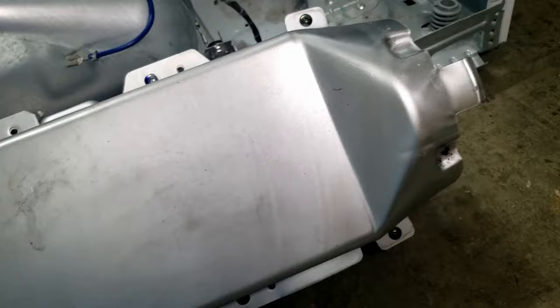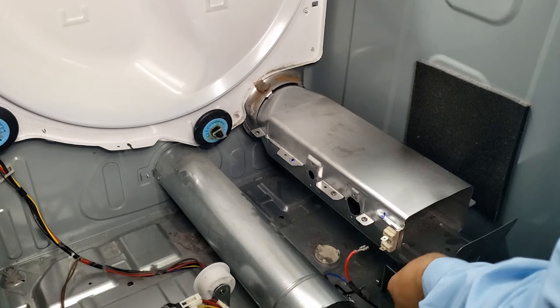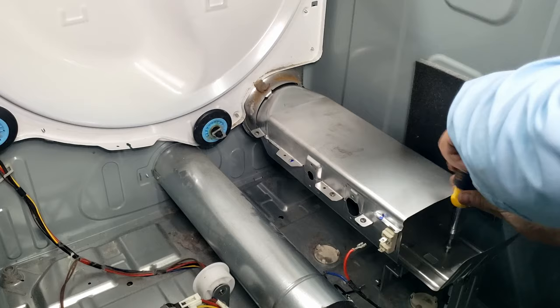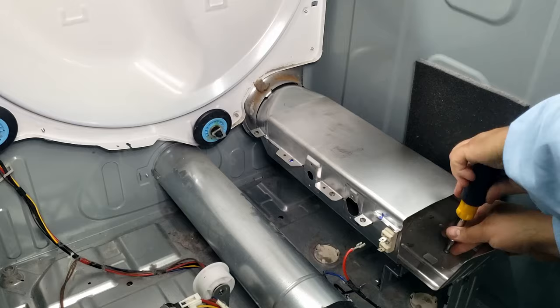Reinstall the screws on the canister — I did this off camera due to how much time was consumed getting the clamshell of the canister to match with the screw holes. The canister has really thin metal so you may need to bend it slightly to get it to match. Install the canister the same way you took it off. In this video I installed the new sensors once the canister was on — only two screws hold the thermal cutoff and thermostat on the unit. Make sure to match the wires up properly as seen earlier in the video, or use this video as a reference.